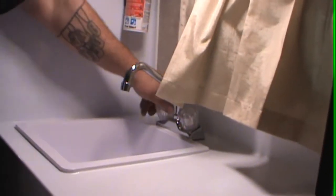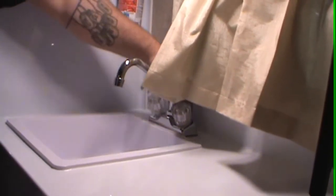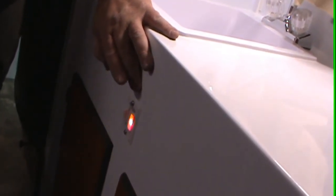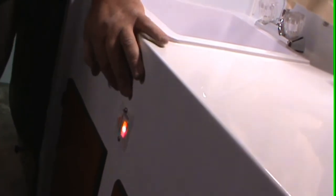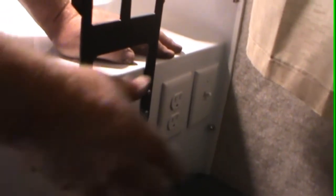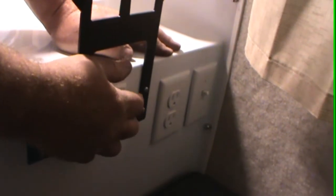When it comes to the water heater, always make sure you hook up your city water or turn your pump on, open the hot water faucet, and make sure you've got water flowing through the system. This is your water heater on gas — when you flip this switch, the little red light will come on, and when that red light goes out it will ignite. It's got a little pre-warmer on it. You've also got the electric option — flipping this switch down will run your water heater on electric. For off-grid camping, the pump switch is what you'll use to get water out of the tank; just flip it on and you'll hear the pump kick in. This can be left on as long as there's water in the tank.